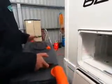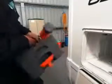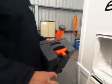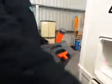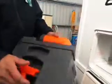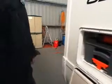So you just go to the disposal point to empty it, and then you just press that air button there. Obviously, take the lid off. And another thing with the lid, normally you have a big funnel emptying point, which usually has a brick wall on it. Don't put the lid on the brick wall, because if you knock it down that hole, you'll probably block the toilet system, or the sewer system, up, plus you've lost that. So put it on the floor behind you. Yes, good thinking. So make sure that it's not likely to be dropped down there.